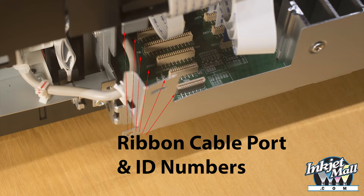Step 10. These cables can be very tricky to place correctly. Do not touch the metal contacts with your fingers. Carefully guide the cable to the lip of the port in the printer and then gently push in. The cable can be bent slightly at a 90 degree angle to give your fingers leverage to push the metal contacts all the way in. There will be a dull thud and then the cable will level off when the cable is all the way in. Do not fray the end of the cable.